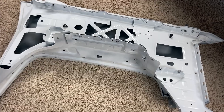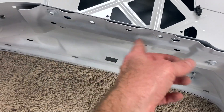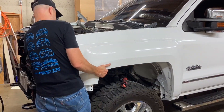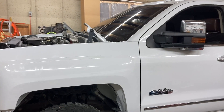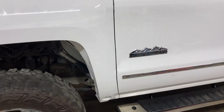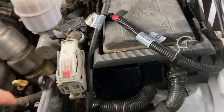I think it's easier to put the fender on without that fender liner on first — you can do it, but it's easier to reach the holes where some clips go in the wiring harness. So I'm going to put the fender on by itself, make sure all the wires are routed right, and then do the fender liner later. After a whole bunch of adjusting and twisting and pulling, I finally got that fender on — the gap is probably 95% good. I just have to tighten up all these little 10-millimeter bolts and then put the battery back in.